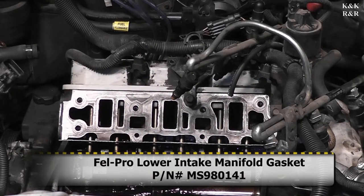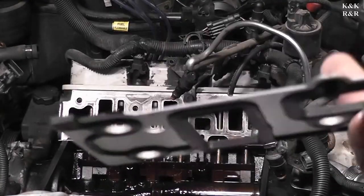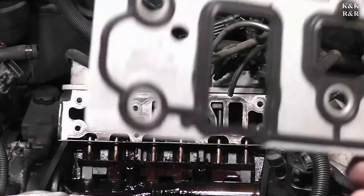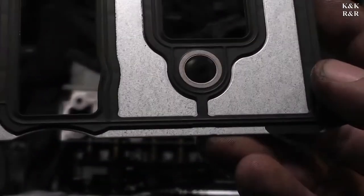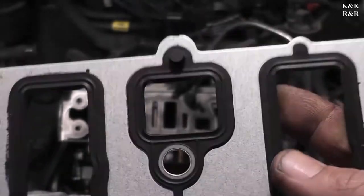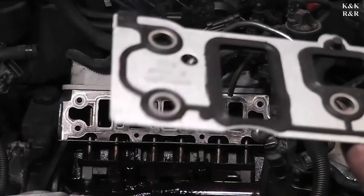At this point we've got a Fix-It gasket by Felpro. I'm going to show you this impregnated gasket right here — it's a nice heavy piece. This gasket fixes all the intake problems. It even has a crush point so you can't over-tighten it, because these only have 88 inch-pound torque readings, which is about 7.33 foot-pounds — not very much. You want to make sure that your surface is all clean so you don't contaminate the new rubber, because there's no RTV except for here in the corner.